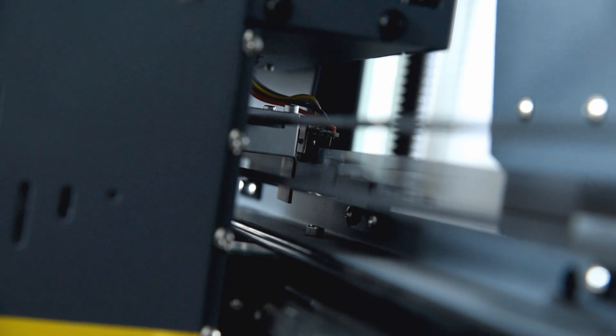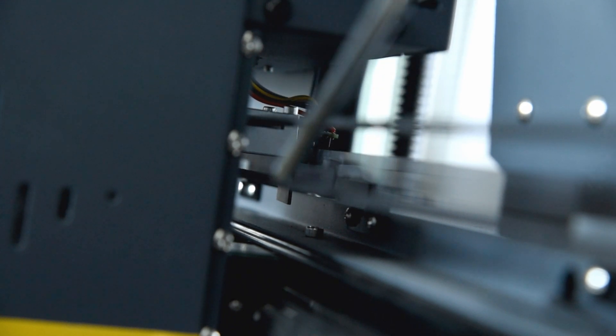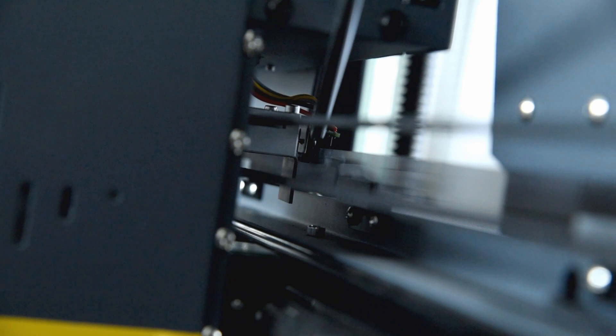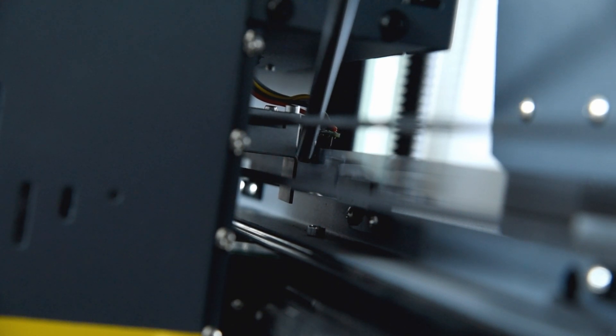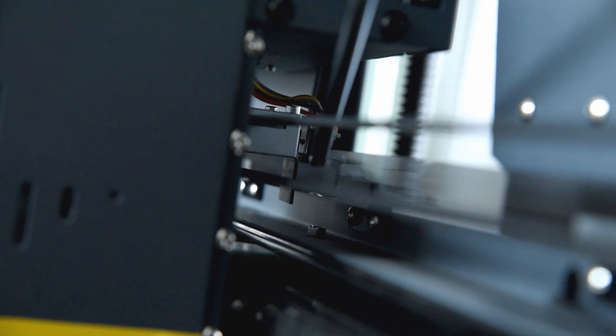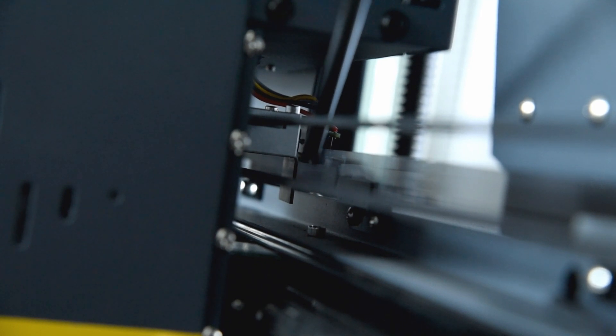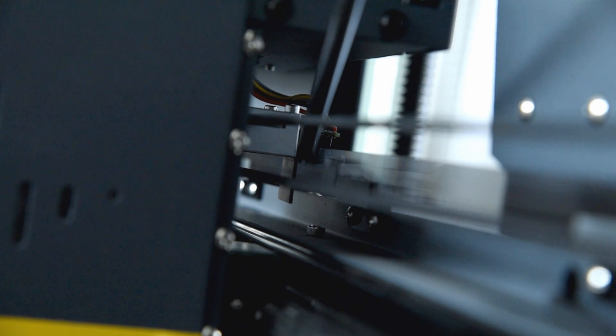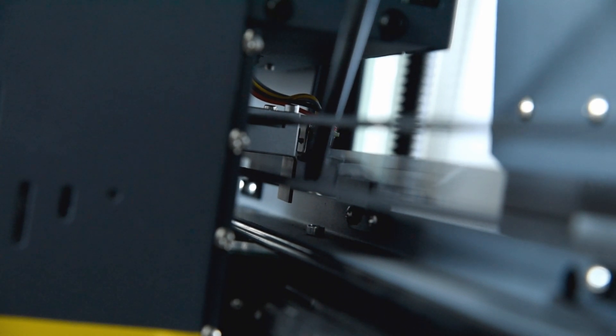When we go to the bottom of the carriage, we can see the encoder film (ink of film) and the encoder sensor. The film must stay centered in the sensor — the encoder film must be at the middle of the sensor at all times. The sensor cannot be scratched by any spare parts, and must be kept clean without scratches. If the film is out of the middle position of the sensor, you will get problems powering the machine or during printing. This is very important — if you get a problem, double-check the encoder film and sensor. If it is dirty or scratched, it must be cleaned or replaced.